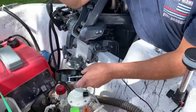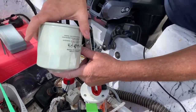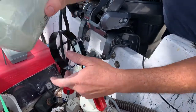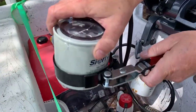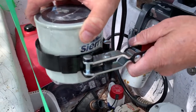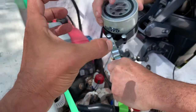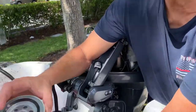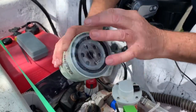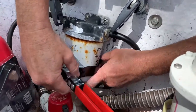So now, show me how this strap works. We're going to be taking it off, so we want to go counterclockwise. We put our strap wrench on it, squeeze and pull back on the wrench — it gets a good grip. Then when you go to push it forward, it's already got a good grip on it, so you don't have to grab it with your fingers and rip your hands apart. Generally, once they're on there for a while they get tight, even if you put it on loose. We want to make sure this one's going to cooperate and break loose for us.